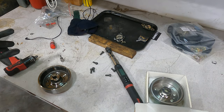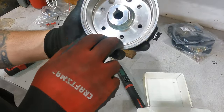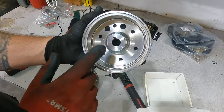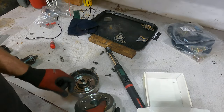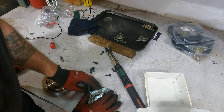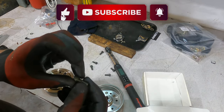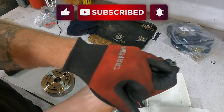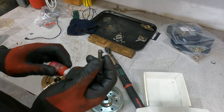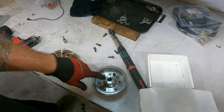We're back with the Arctic Cat 400. As we said before, seeing the magnets come off is a very common issue. Here is the new style rotor - it's all encapsulated with metal around it, so it doesn't have that opportunity to come off completely. There's always a possibility they could come loose and move, but this is the updated version. What we're gonna do right now is take the one-way bearing and stuff off the back and put it directly on this other one. We'll add red Loctite to all these 8mm bolts - it's a 6mm socket hex head Allen - and torque them down to roughly 25 Newton meters.